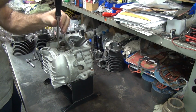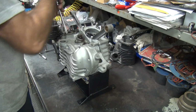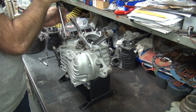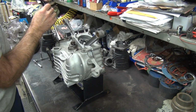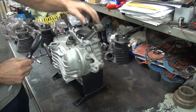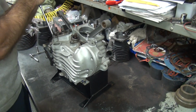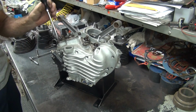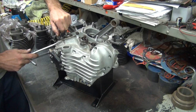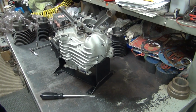Oh, yeah. Hard putting those parts in there. Now these are Sportster rods, so you have to do more clearance because they're bigger. They're wider in the beams than a 45 rod. So you get a stronger crank, but it's light enough to have the stuff on top. Jeez. That was on there. I don't think those are going to come up. So we put them in tight.